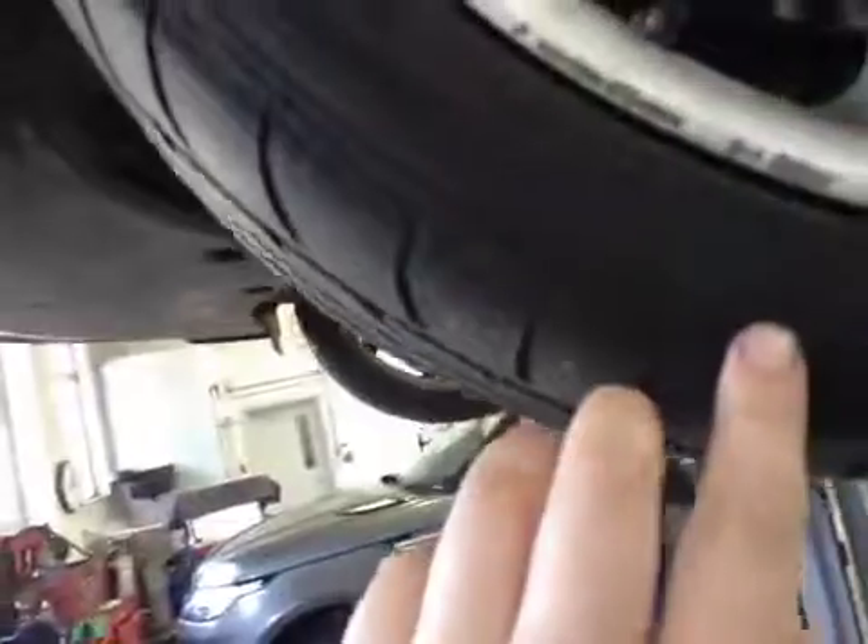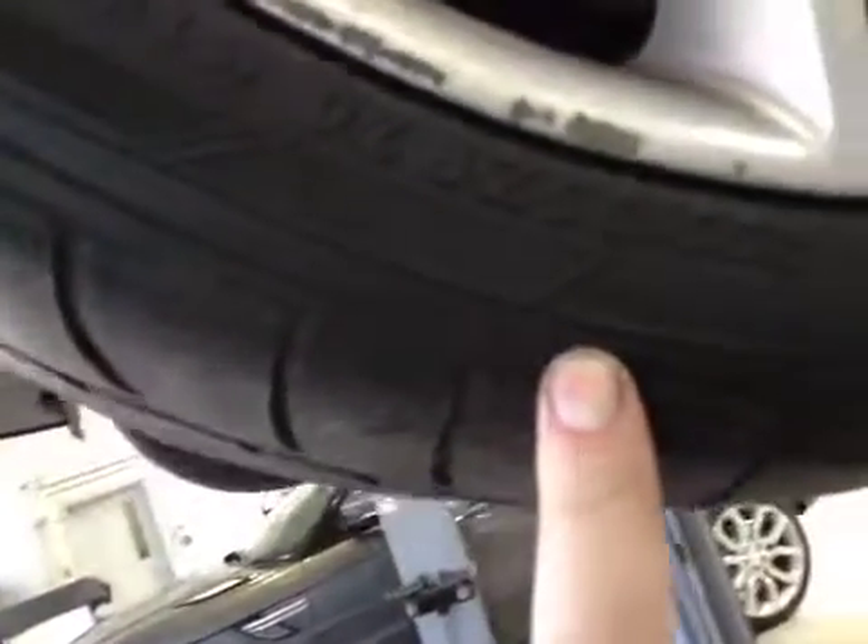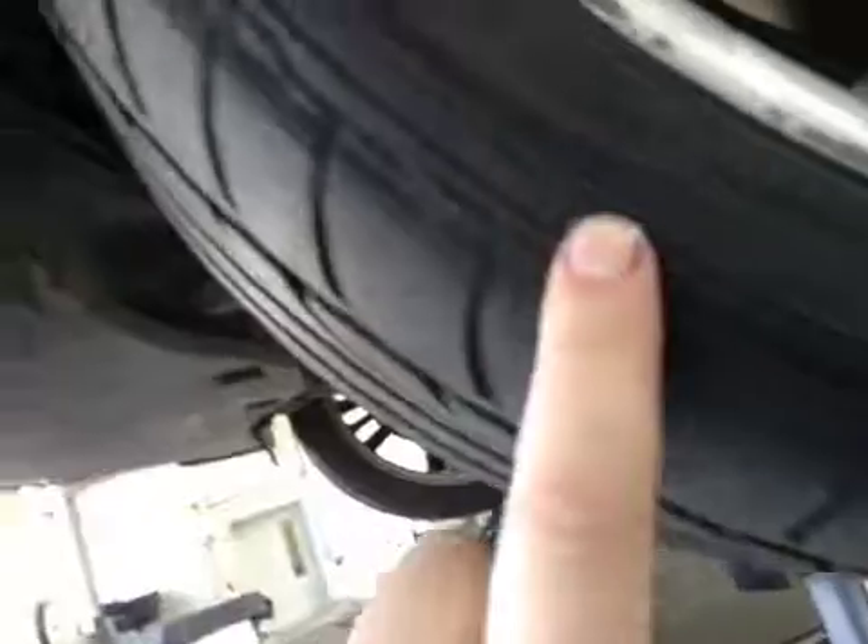If we come to your near side front, inspecting the near side front tyre, I have marked this tyre in red as the sidewall, as you can see here, is splitting all the way around.